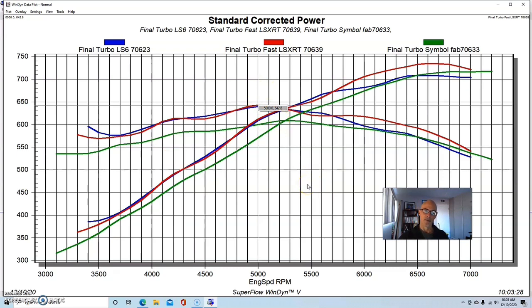The FAST manifold makes more than any of the factory intake manifolds and in this RPM range it's very hard to beat. A common concern from turbo guys is that the FAST leaks boost — but I've run the FAST on turbo applications probably 50 to 100 times, up to 25 or 26 pounds of boost, and I've never had that problem. I haven't run 40 or 50 pounds, so maybe at very elevated boost levels there could be an issue, but up to around 29 pounds I have not had any sealing problems. For most applications at 7, 8, 10, or 20 pounds, I don't think you'll ever have a problem.